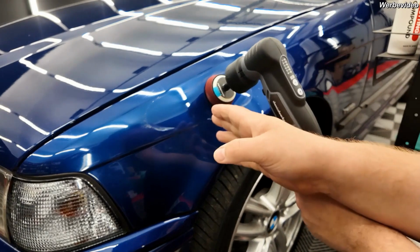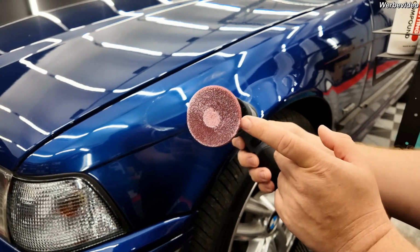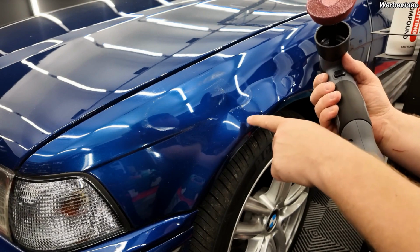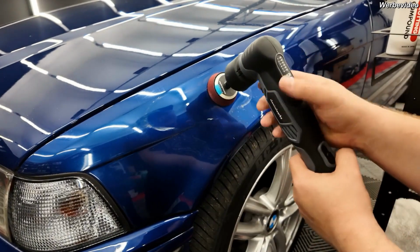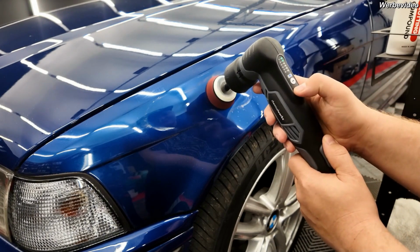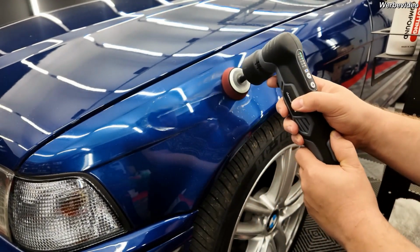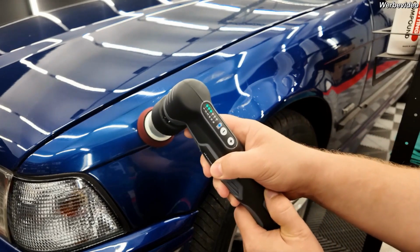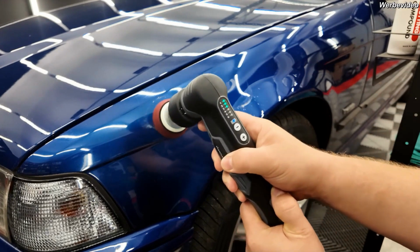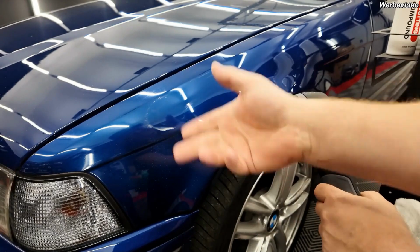What I have just shown you is just working in the polish, spreading it so that it distributes a bit further in the pad. You can see here that if you do this too quickly, if you increase the speed too fast, you immediately get these large splashes, but here it remains within limits. Normally, it is much worse. I can provoke it by now making too much speed too early. Okay, I had already worked it in too well. It is already well distributed.